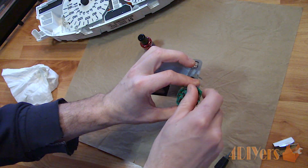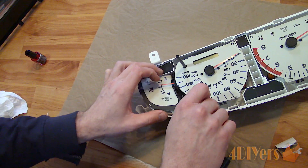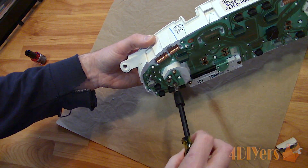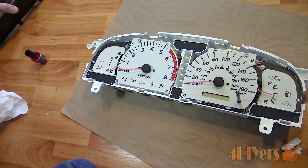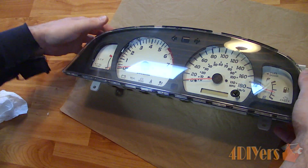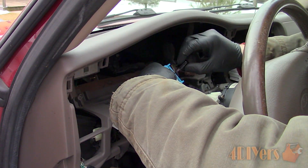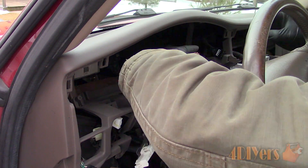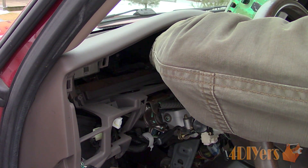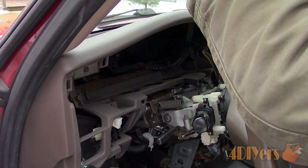Reassemble the gauge — again tighten those terminal nuts. Pull the speedo face out, then install the fuel gauge. Install and tighten those three Phillips screws in the rear. I did clean the inside of the lens as it can attract dust. Then install the lens assembly — make sure all the clips are aligned and it's pushed back into place evenly, then snap the assembly together. After that, install the gauge cluster back into the truck. Apply Deoxit D100L to remove any corrosion, protect the connections, and improve connection conductivity. Only a light amount of solution is needed — the supplied small brush in the lid makes the application extremely easy. Reconnect all the connections, then screw the cluster back into place.